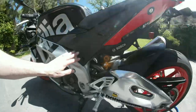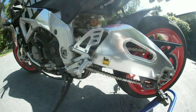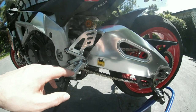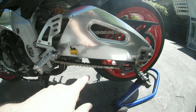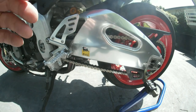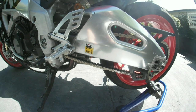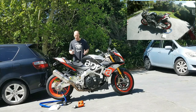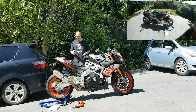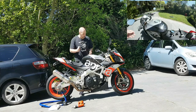One other thing I was able to do myself was maintenance on the chain — this is actually a new chain. When the bike went in for the coolant issue about four weeks in, they replaced some pipes and gave me a new chain because the old one was pretty messed up. I've cleaned it and put this white lubrication on it — it sticks to the chain and stops the gunk coming off. I kind of hate how it makes the chain look dirty, but at the end of the day you want the longevity, and that goes for the sprockets as well.